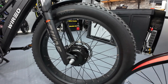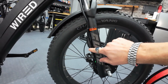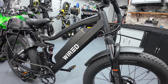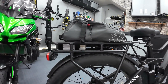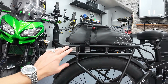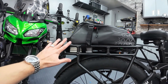It's a 52 volt 750 watt motor. Coming up the forks, you can see the motor wire — I've got it zip tied onto the forks, crosses over, and goes down the backside of the frame. Moving to the back: I've got my controller mounted right here to the back of the rear rack. It's really out of the way and pretty hidden under there. I just have it Velcro strapped onto the rack since I've been taking this kit on and off the bike a lot.